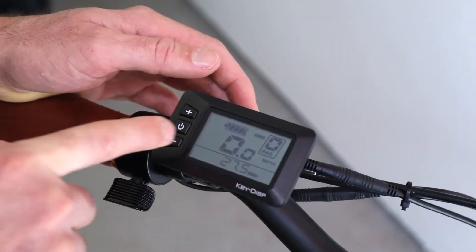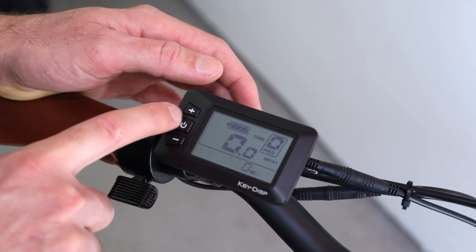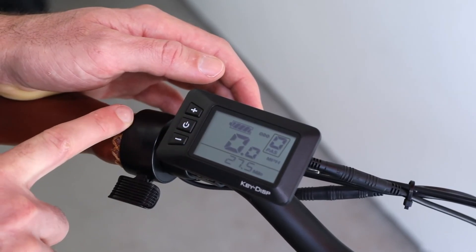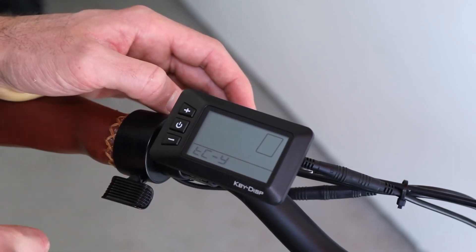N is for the number of magnets — let's save this at 12 and move on. When you register and save these settings you will notice the difference in your pedal assist when you start riding. If the acceleration feels too sudden, I would change the SCN number back up.